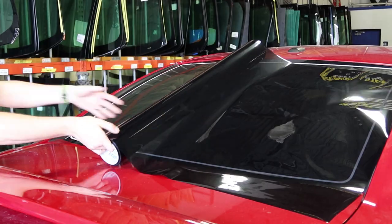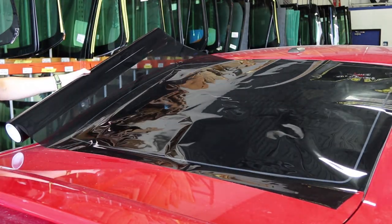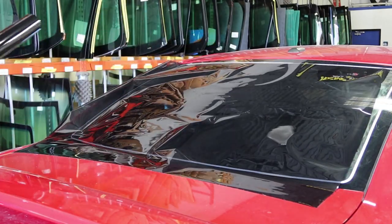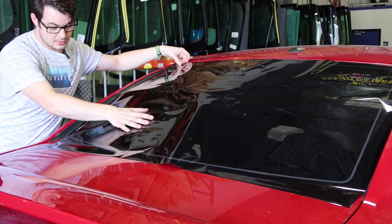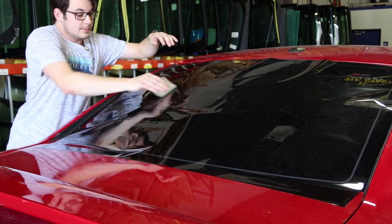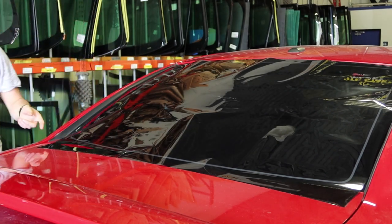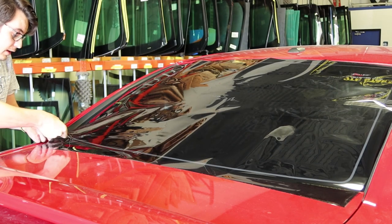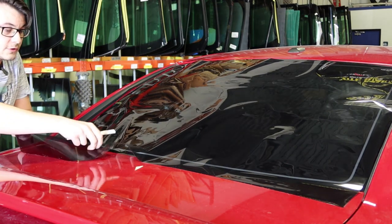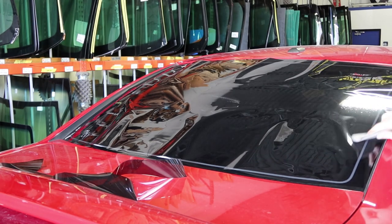This is a high-quality color stable lifetime warranty dyed film. I've been using Avery for a couple of years and really like it, so if you see me shrinking something in my videos it's often this film — not sponsored unfortunately, but I wish I was. This is a 36-inch roll. We've got to unroll this vertically and we're going to be dry shrinking it. That's the easiest way to do this back window and you also save the most film with a 36-inch roll. If you use a 40-inch, you can take the bottom extra that I'm cutting off and move it over to quarter windows or possibly a windshield strip.